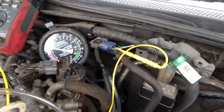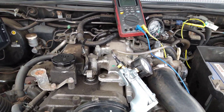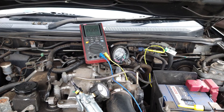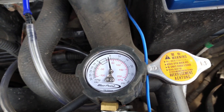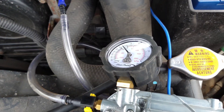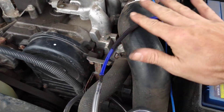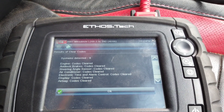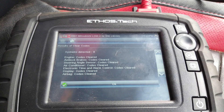The pressure sensor is working fine — we just need a new hose. That's why you can get ABS faults from something totally unrelated. In this case it's just a hose. Found a new hose, plugged off at the end for the same pressure test. Applying pressure — it's staying this time. Confirmed the new hose holds pressure and vacuum. Connecting it up, clearing the fault codes — it should be okay now. All modules cleared.